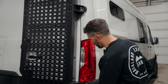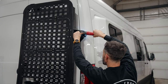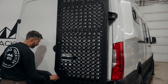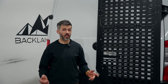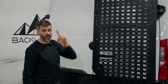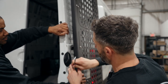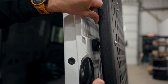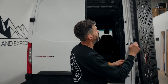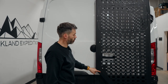Now it's time for the final torque on the hinges. Make sure that every single bolt is tightened including the one that we put through the door. As you've seen, our carrier is attached to the door through the hinges — two brackets going through the door — but that's not all. With the help of a second person, spread the carrier apart from the door. Use your tool and unthread the vibration dampener until there's pressure on it and just release it. The idea behind this is that when you close the door, the weight is distributed on three different points.